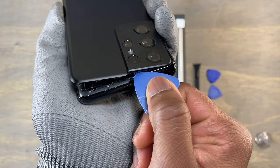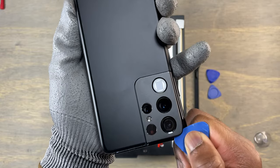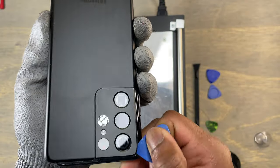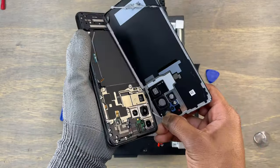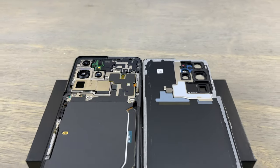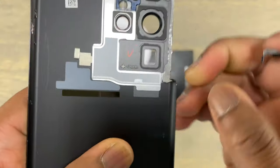Always remember to use a little bit of extra heat if your guitar pick starts to get harder to move. Since this back cover is not made out of glass like on the Samsung S20, there is less chance of cutting yourself. Working with this plastic back cover makes it very straightforward and easy. Try to preserve everything intact around the camera bezel because we are going to transfer some of those components onto the new back cover. The only problem I see with this new two-piece back cover design is water resistance — I would prefer Samsung to use the design they made for the A52 or A72.